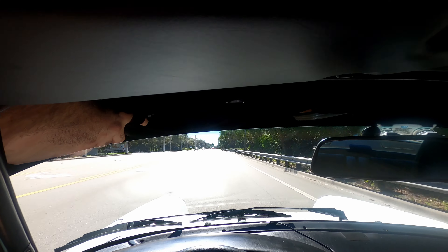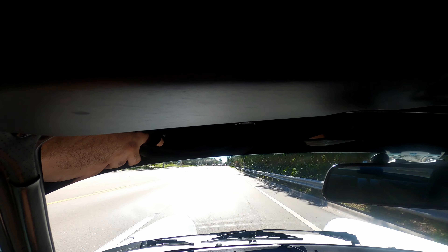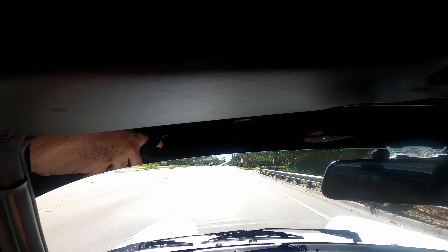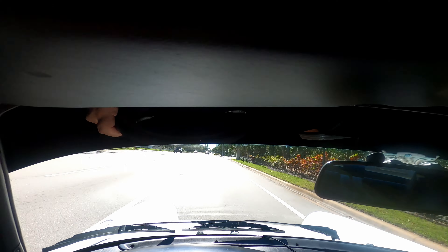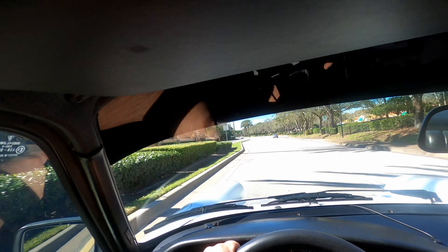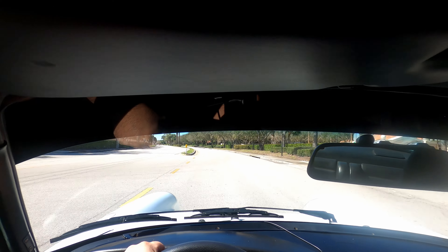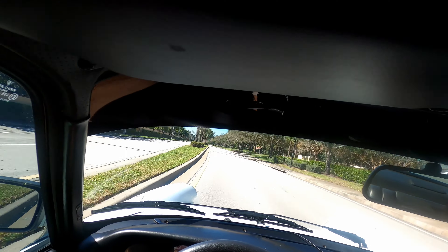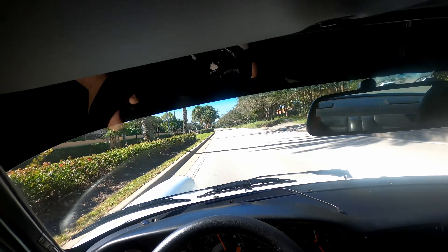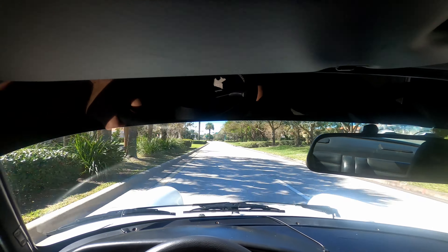You can drive this car around town, you can be a bit of a hooligan with it — just don't try to shift it too fast. Stock, I'd say don't go much over 6000 RPM. This one has titanium valve retainers, better rod bolts — it's able to withstand higher RPMs. I just want to show you what the driving is like when you give it the beans.